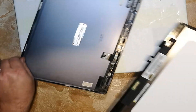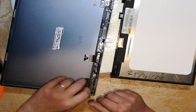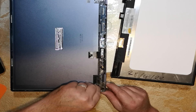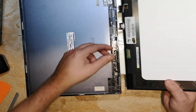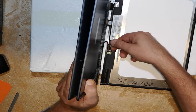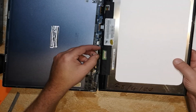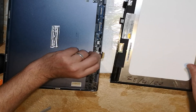Just having a good look to see how all the ribbons go back on. I don't know why, but I made a mistake here — so I learned by this, don't make the same mistake I did. This is important: all three ribbons get put in at the same time at this point. If you do what I did and connect one ribbon on this side and then try to do the other two from the other side, it's not all going to go wrong — in the end I was successful — but it makes the job a little bit harder with extra work you didn't need to do.